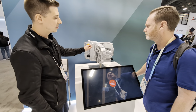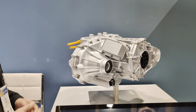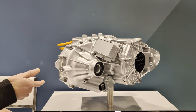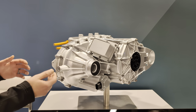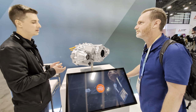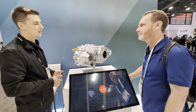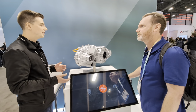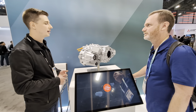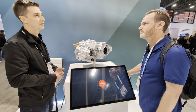Another cool mechanical function is our active fluid control. This is an electric pump, which is pretty industry standard on eDrives now. But the secret sauce is a special manifold that allows us to rotate the motor in two different directions — in one direction we cool certain portions of the eDrive needed under different use cases; spin it the other direction and oil flows to different areas that require cooling. This is important because electric motors need to be cooled differently at low speed/high torque versus high speed/high power driving. We can cool the winding heads and the magnets independently, or shut the system off for higher efficiency.